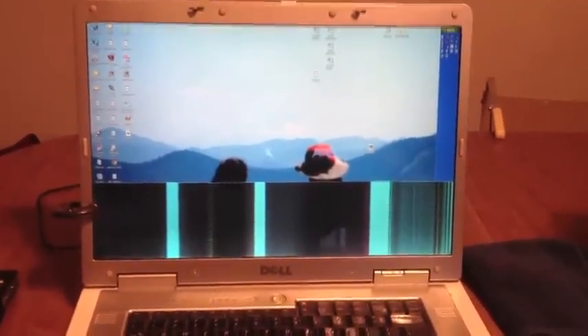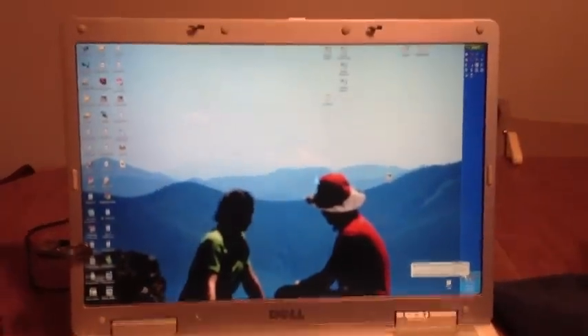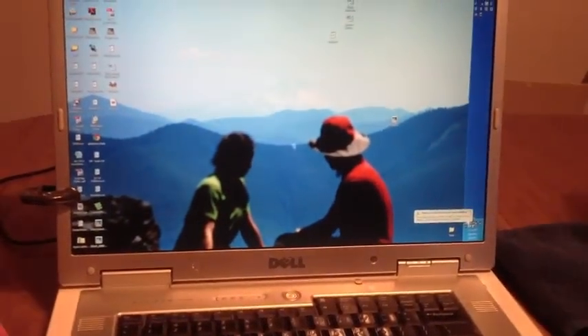Alright, so here's the computer, and there's the lines I was talking about. The C-clamp is a little bit loose, that's why the vertical lines are still there. So let me just adjust that, and there we have the screen working perfectly. So the first thing I'm going to do is try to take the screen off. I noticed there's a couple little covers here, and I'm guessing there's a screw underneath there — yes, a little Phillips screw. So I'm going to take both of those off, and then I'm going to shut down the computer, and we'll go from there.